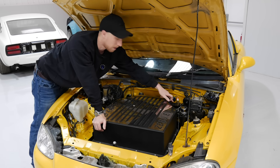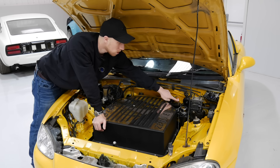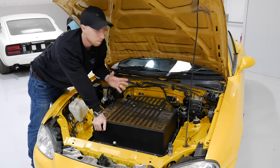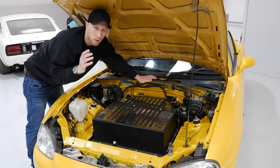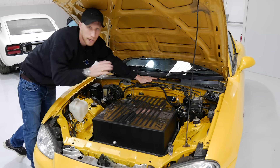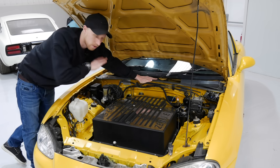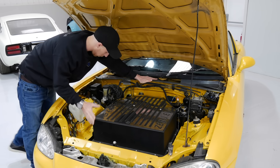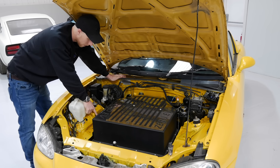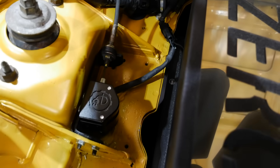We have a valve block with a sensor to shut the pump down when it reaches vacuum pressure, and we have a storage tank for that as well. The reason we run a storage tank and sensor is so it's not running all the time — once it gets to pressure it stores it, so when you press the brake pedal you don't get the pump kicking in all the time, which is a horrible thing to have on EVs. You want it to be as silent as possible. We also have our Zero EV throttle pot developed in house — this is the cable drive version, but we also do a lever version.